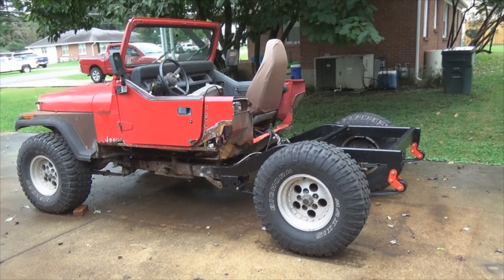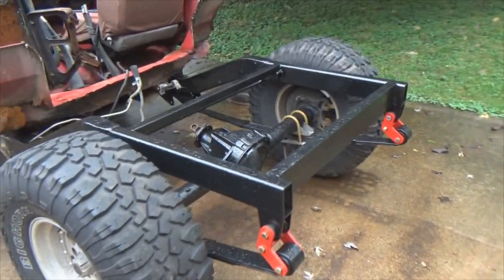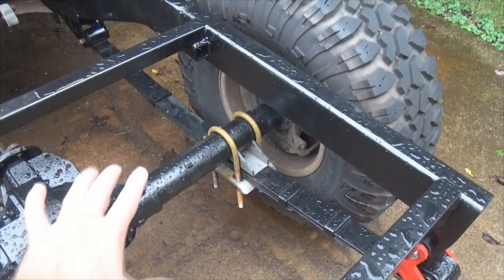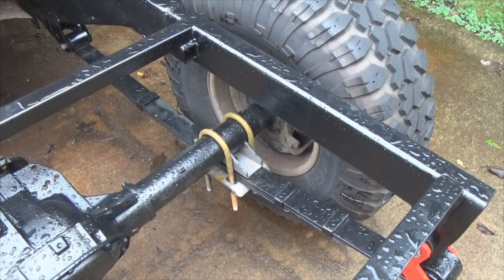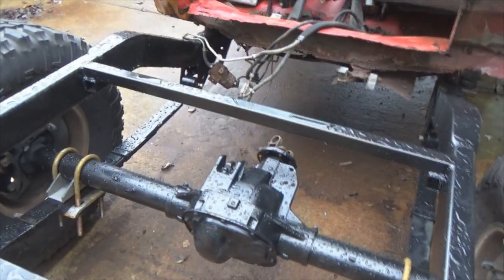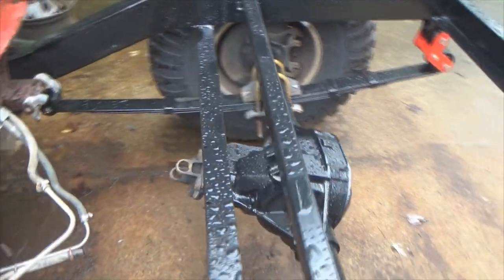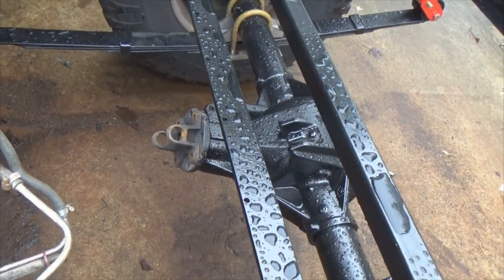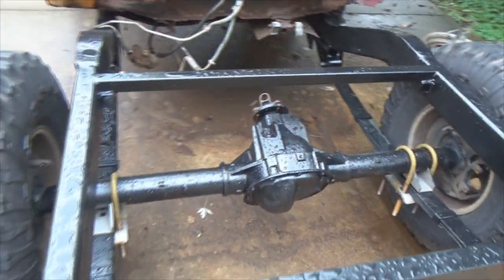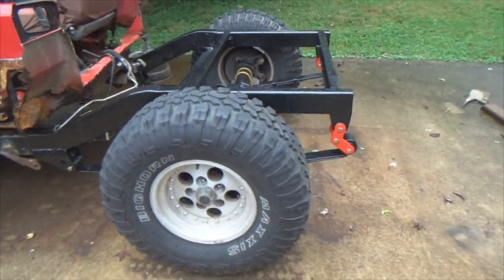End of the video showing that the stretch is welded in, but look where it's actually at the moment. The 8.8 is bolted in, pinion angle is not set, but my spring perches are just sitting there at the moment. I still got to set my pinion angle. Spring perches from Rough Stuff Specialties — super solid stuff. You'll see the video when it comes out when I prepped the 8.8. Got the pinion angle kind of sort of where it should be, shooting up toward the transfer case with the stretch and the slip yoke eliminator installed. That's where she's actually at the moment, which means there's more videos to come. Be sure you subscribe.